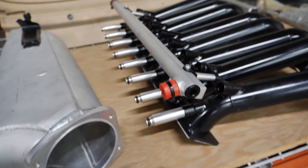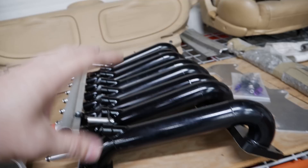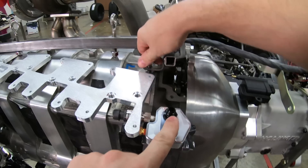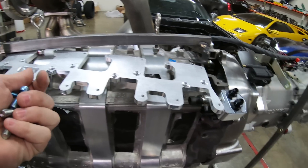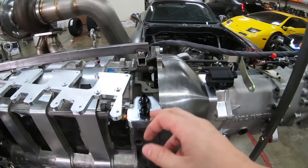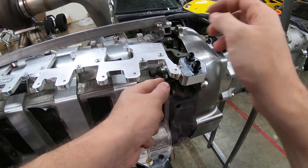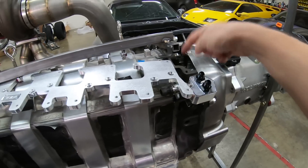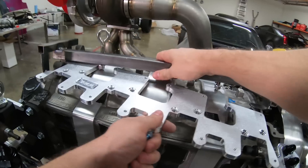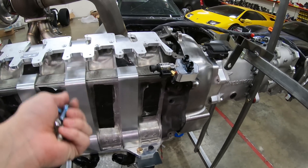Other fuel rail goes on. We'll run the fuel to the rail. I'm going to switch to GoPro and put this onto the engine to get a more clear idea of where things are going to line up with everything else. Huge thanks to Max Flower — he's MadMax26B Turbo on Instagram. Max saved my ass by saying, 'Hey Rob, there's your oil pressure regulator right there. This is capable of adjusting the pressure properly. You don't need to use the stock system.' So I am going to block this off. It changes my plans with temperature and pressure sensors. Rear iron still gets the bearing oil — the rest of the system blocked off.